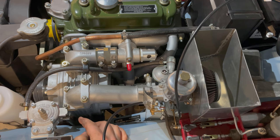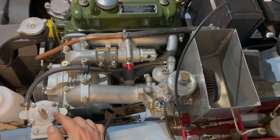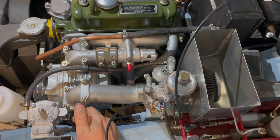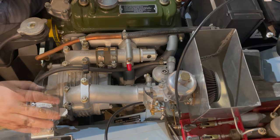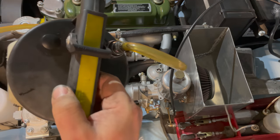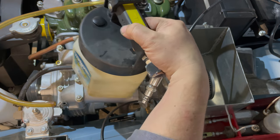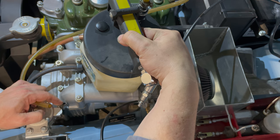We have oil on that side of the engine, but we still don't have any fuel coming up on this side. I'm going to take off the hose that comes directly from the fuel pump up to the filter regulator — I want to eliminate the carburetor or regulator as a possible cause of why there's no fuel coming up yet. With this hose off I'll crank the engine over to see if we can get fuel to come out up here. Nothing's coming out, and since I had to put fuel down this hose manually, I don't think the fuel pump is running. What I'm going to try now is using my fluid evacuator — this will put a constant vacuum on this hose so I can try to suck fuel through the fuel pump and up through the line.